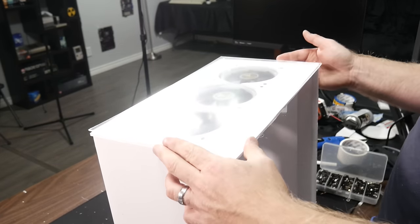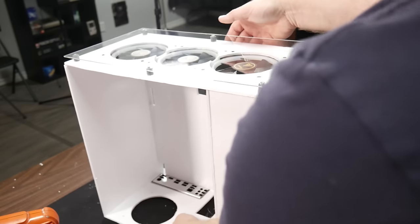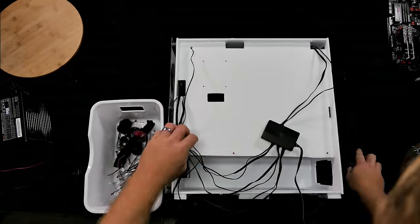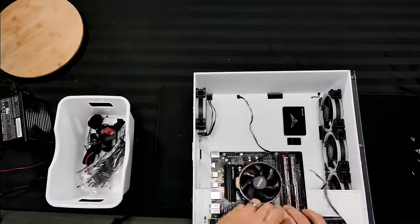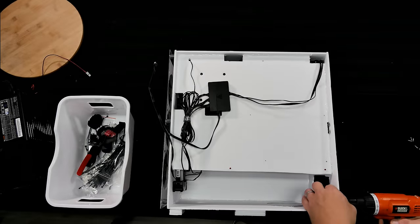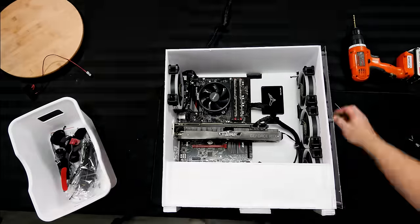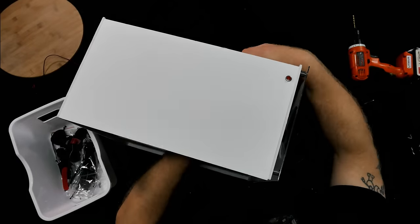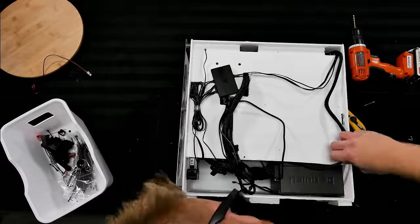Check out the acrylic for the front — I had that piece lying around and just made a quick cut. I used standoffs from stock coolers, screwed everything right in there super easily. Got the back fan in, then it was time for cable management and assembling the whole case. It's flimsy so you've got to be careful — I used screws right through the motherboard into the foam board. A heavier cooler might have been a bad idea. I made another hole for the 24-pin power connector, and it really came together.